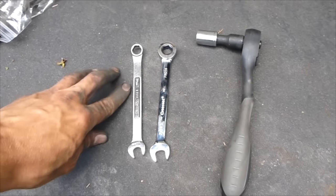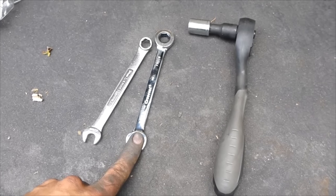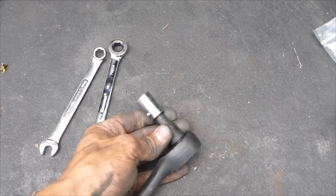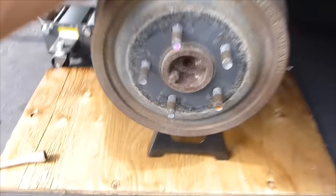So there's a 10mm for the bleeder valve, a 7/16 for where the brake line goes into the wheel cylinder, and then the two bolts that go onto the wheel cylinder and hold it in are 1/2 inch. So I'm going to just start with looking at the wheel cylinder and just showing you that. And that's right back here, and also behind this drum,